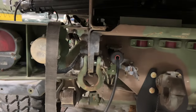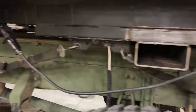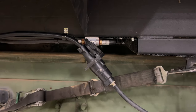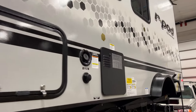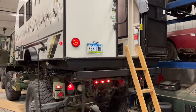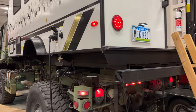Now the box is plugged into the trailer connection on the truck, comes up over to here, goes through the extension, and then over to the original trailer connection on the trailer. Let's turn the lights on and see if it works. All the trailer lights are on, and I left one of the turn signals on so we could see that working. Now the brake lights, turn signals, and license plate lamp — everything works along with the truck. I just need to permanently mount the box somewhere and then tie up all the wiring.